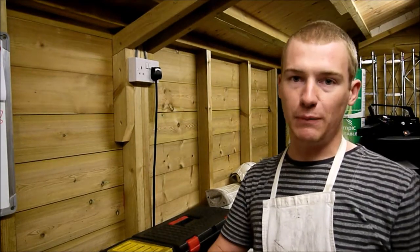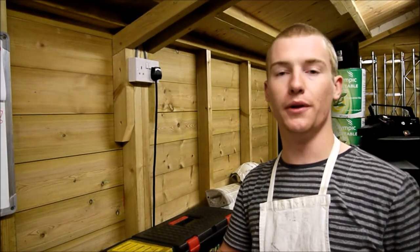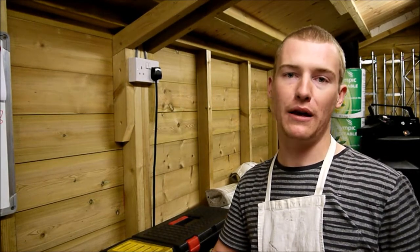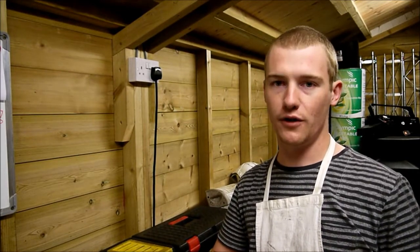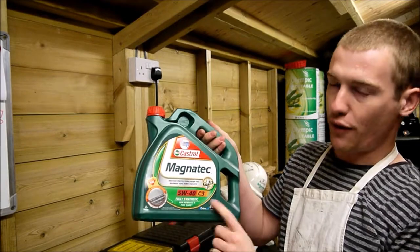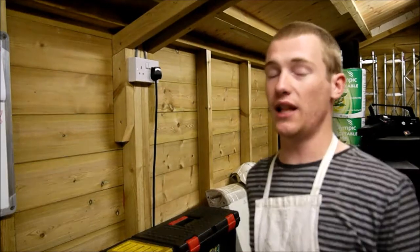As for oil change intervals, many people choose to change their oil around the 10,000 to 12,000 mile mark. In the UK that's what the books recommend. Modern cars tend to have these ridiculous 25,000 miles between oil changes — I personally think that's a load of crap. I do my oil every 6,000 miles. The vehicle we're doing today recommends 6,000 mile oil changes in the logbook, although when that engine was fitted to more modern vehicles they upped it to 10,000 mile intervals. I'm going to stick with the 6,000 mile mark.